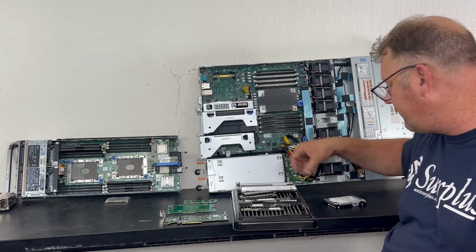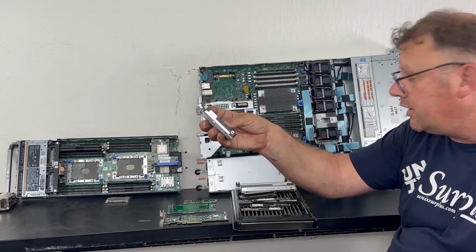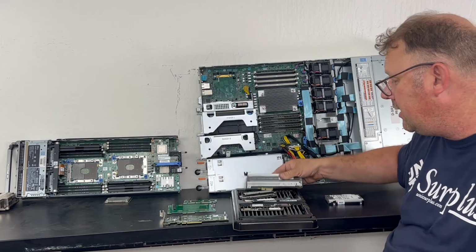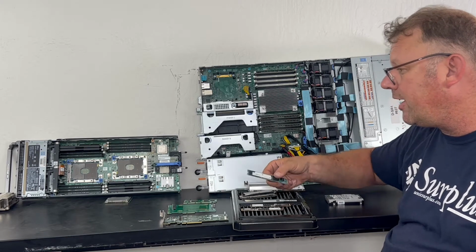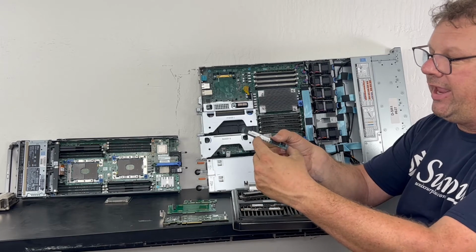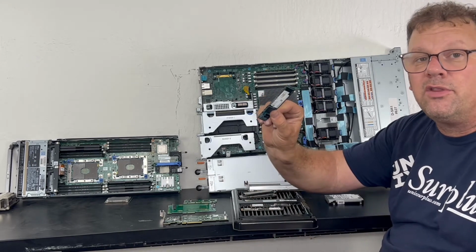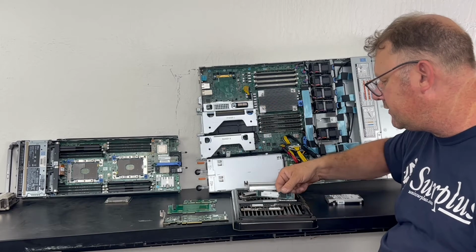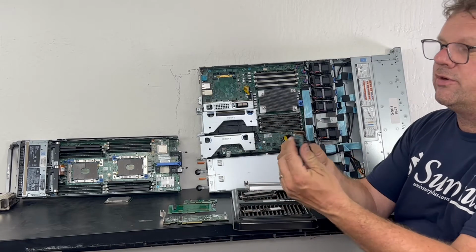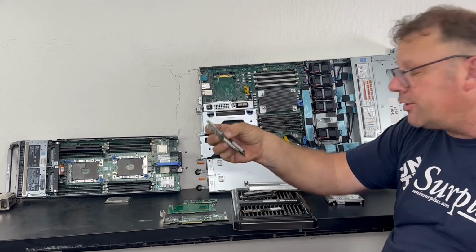We talked about the different formats, like the ones that go in and out, such as a 2.5-inch hard drive U.2, and even some of the PCIe cards that were made classically. And then we have the different size formats from 22110, 2280, and 2260 to fit in your Intel NUC. These are all the different M.2 formats. We talked a little bit about notching and how that's different between two different drives, and if you can have a single or double notch, if you support SATA mode at all.